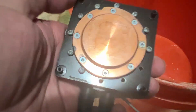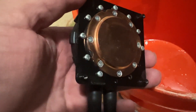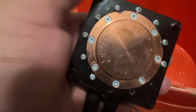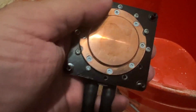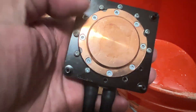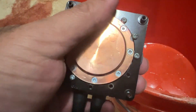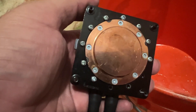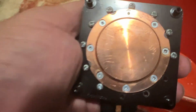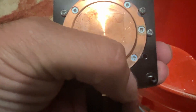I also tested the pump — the pump does work. Some screws are missing, but I'm going to remount it correctly so it makes full contact with the GPU. For now I'm filling it with water just for testing, then I'll drain it and put better coolant in. The coolant that was in there was pretty dirty and I expect the radiator is still somewhat clogged, but with correct contact we should at least get normal temperatures. If that works, we'll go ahead and find all the missing parts, including the cap.